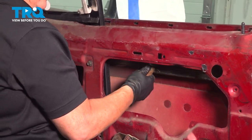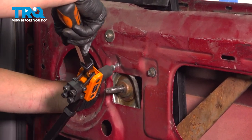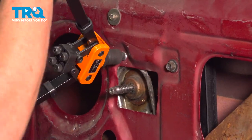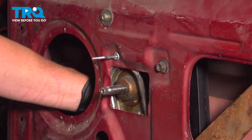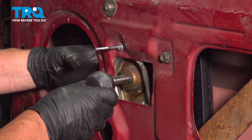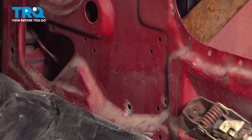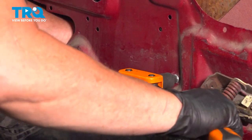I'm going to guide this window all the way up and then re-tape it up there. Now I have my first rivet hole lined up with the regulator — put the new rivet in. I'm holding it in place and I'm going to get my window crank and crank that down until these two holes line up. There's one and two — make sure it went through.